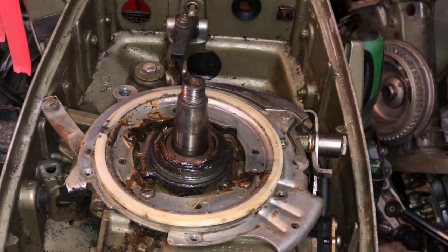One of the reasons I decided to do the crankshaft seal on the other one is that I did have a lean pop that I couldn't get rid of. The upper crankshaft seal did not have any leaking coming out of it on the other motor, but I replaced the bottom crankshaft seal and I just decided to go ahead and replace the top one also.